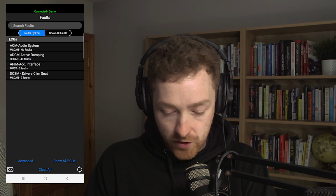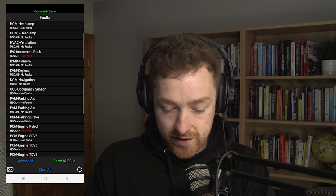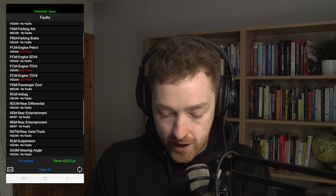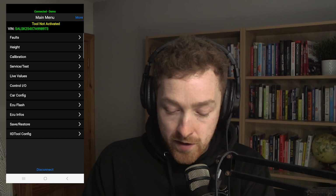And if we want to clear them, we just click clear, and that's the faults gone. We can clear all here, and the faults are gone. We can also click show all ECUs, and we can just scroll down and see what's fitted, what's not fitted, and then if there's faults in any of the specific ECUs. So very, very handy.